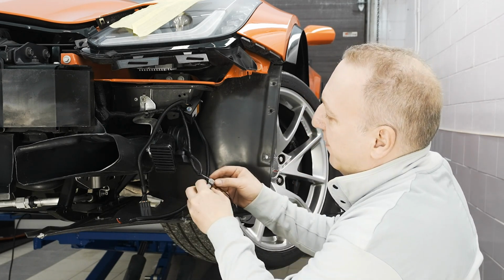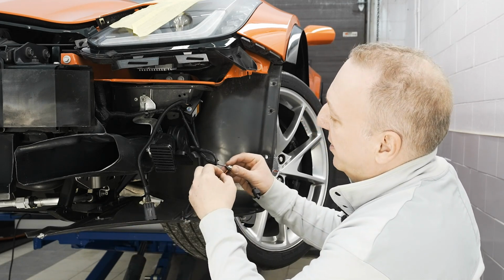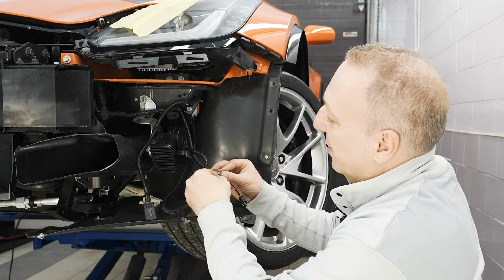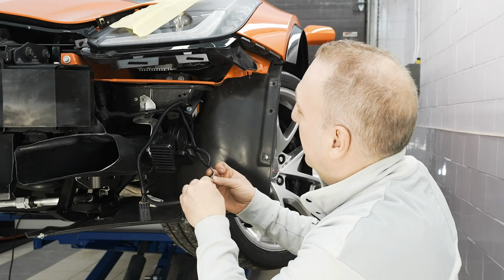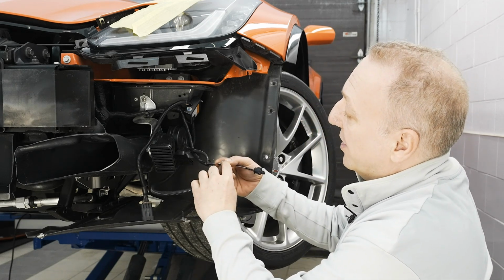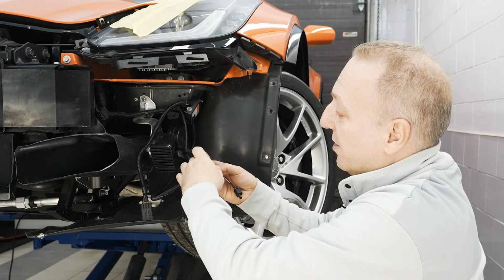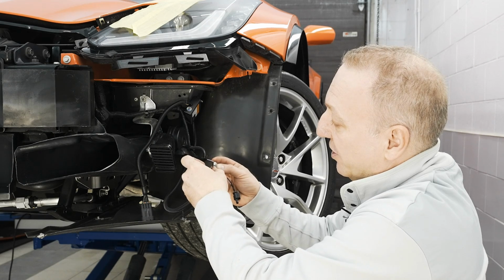I feel the snap. So now what do we recall? The colored one on top, that means a colored one on the outside. I can actually see through the T-tap as a little reminder. Really important. At the bottom portion, there's actually a hole for the wire to slide into, so you can't really get it wrong. You do want to make sure your wire goes all the way through, because that's where the connection's being made.